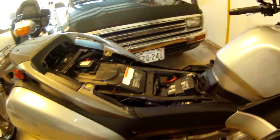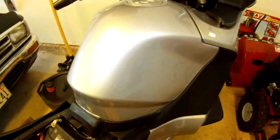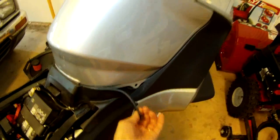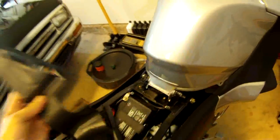The first thing to do is take the seat off. Once you've got the seat off, you want to remove this tank rubber here. That's just held in with a couple of tabs, so you just pull that off — you can see it held in there — just comes off. Pull off the other side and you can put this away.